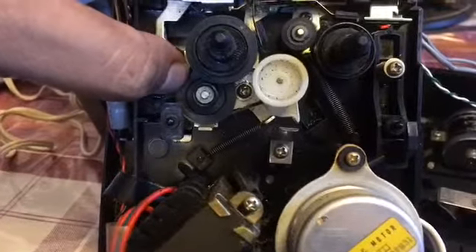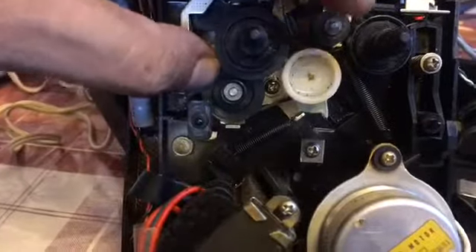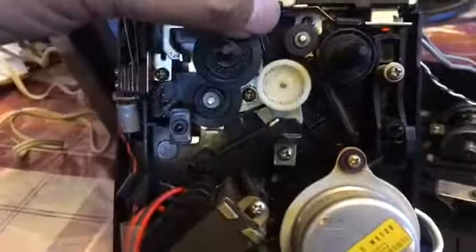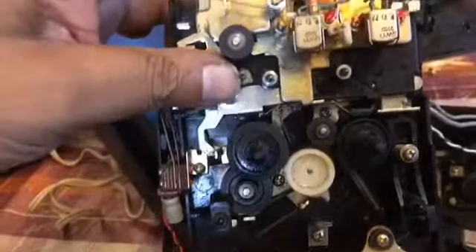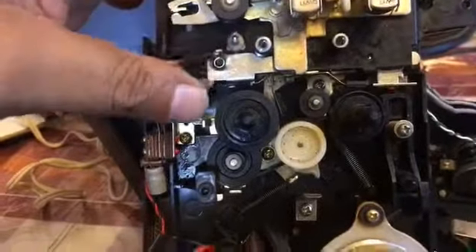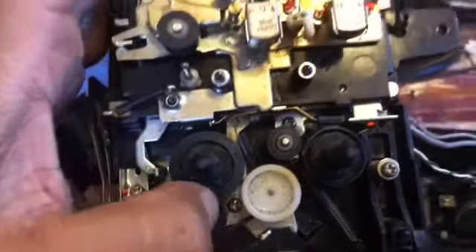To change it, you just take it off that pulley, off this pulley, and off it comes. I had a spare that was a bit tighter so it'll grip better. While it's out, I cleaned this rubber piece — used a bit of sandpaper and spun it around. Slight sandpaper on the idler while spinning it, just to take that finish off, then gave it a good spray with isopropyl alcohol and let it dry, then cleaned it with cotton buds to make sure there's no residue.